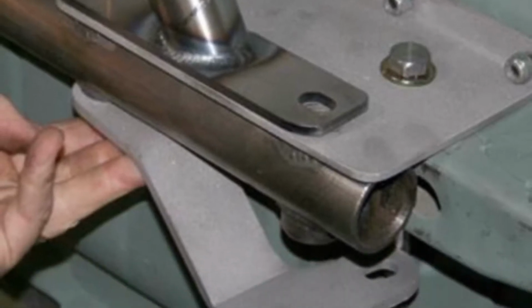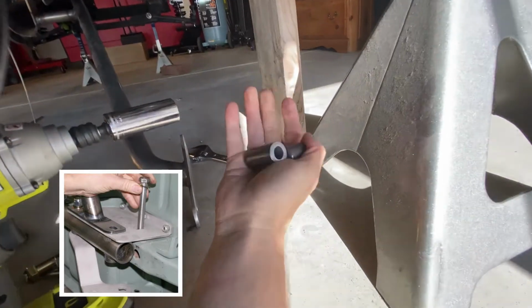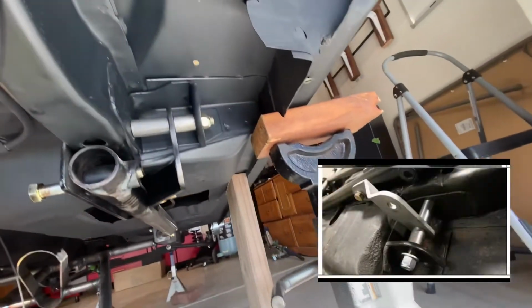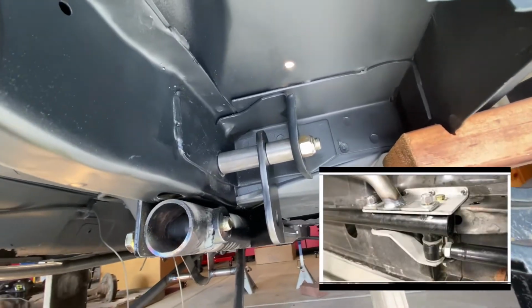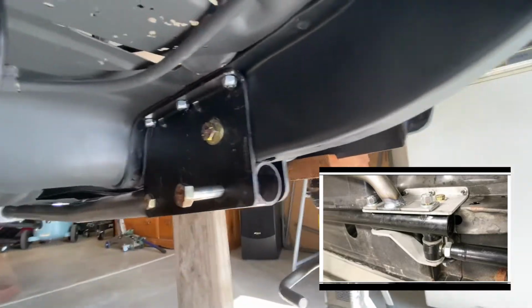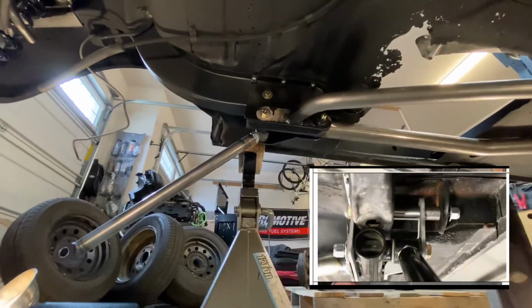Pick 15. With the rear of the cross member lining up with the rear holes and plates. Pick 16 and 17. Pull the 6.5-inch bolts out just a little bit and reinstall with the sleeves, the larger sleeves on the inside. Pick 18 and 19, page 6 of 14. Install the link bar in the lower hole using the last bolt alert, 5.5-inch bolts, 2 of them. And that's the last bolt alert of the first 10 bolts.